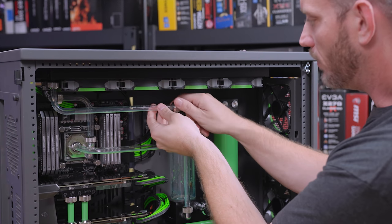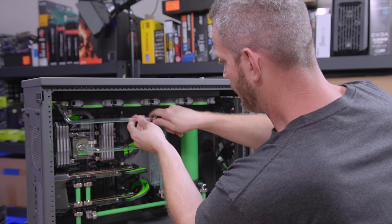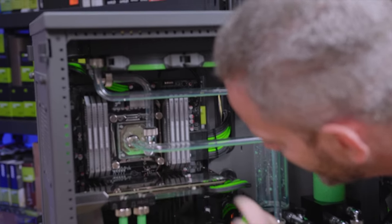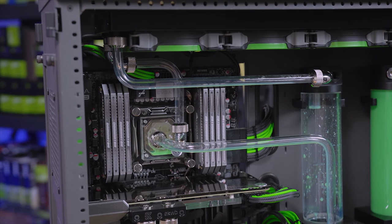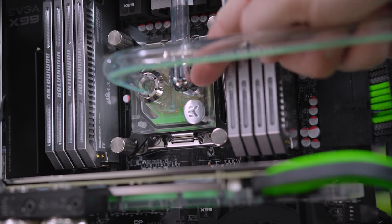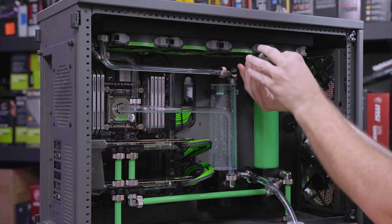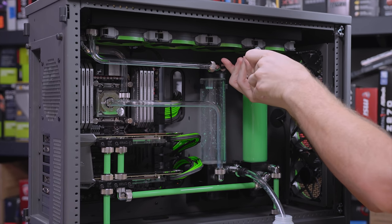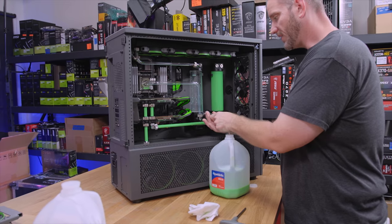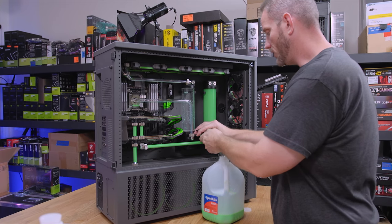The reason I'm not concerned about blowing in there is these fluids are also growth inhibitors so you don't get things like algae and bacteria growing in the loop. If Phil gets in here, you can see that block is extremely clean — no real discoloration, no powder buildup. It's maybe slightly yellowed, but that's normal when nickel has fluid running over it. That actually looks really, really good. But if there's any sediment building up, it would probably be in the GPU rig because temperature can really break down a fluid quickly, and the GPU loop gets significantly hotter than my CPU loop.